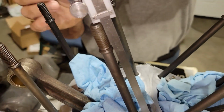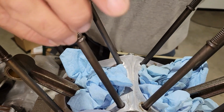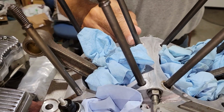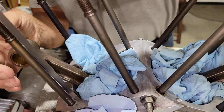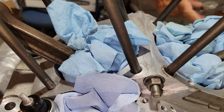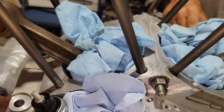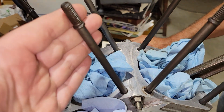If this was my motor, I would say that'd be good, because then you'd take extra torque before you'd ever hit this. But at this one and these other ones that are high, you run the risk of bottoming out. At the Harley shop, if a 94 and older Evo motor came in with base gasket problems, we were told to pull the top end apart, switch out the gaskets, and flip these studs over according to that service bulletin.